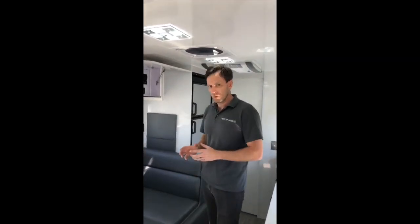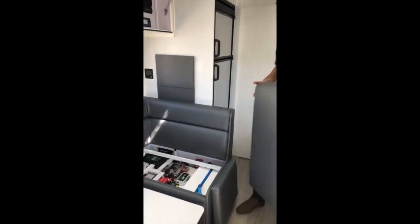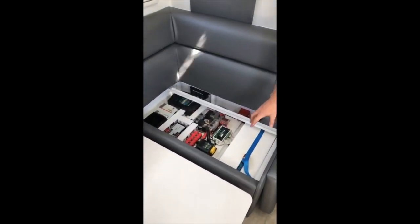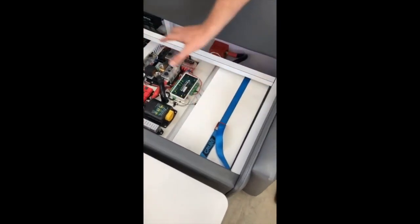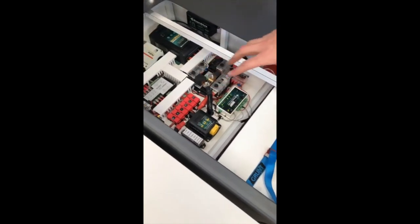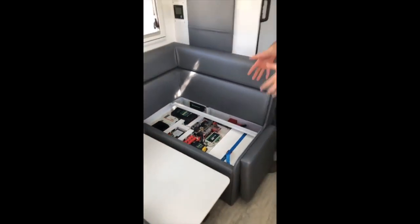When we want to go bigger, we put in a 300 amp — it's the white pack. The white system is quite a bit different, and we need to go to that because of the rate of discharge we can get out of these Enerdrive batteries. This is actually a 300 amp battery pack — this is the battery in here. When we put this in, it's a completely different management system. We've got all the BMS, low voltage cutouts, relays and stuff — all supplementary items that have to go in here to get the big pack in.